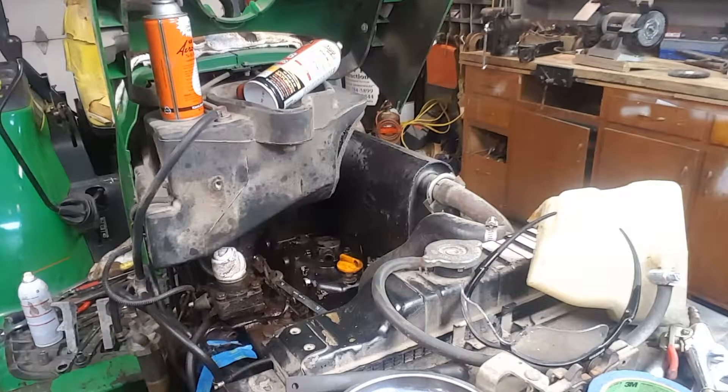This is a three-cylinder Yanmar engine out of a John Deere 4210. It's a 2002 and they've stopped making some parts for it. I had to go online and research it down. I found the center fuel line, bought one used, and got the first and third one out. Now I'm working on the center. Maybe this will help teach somebody and pass it on.